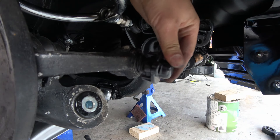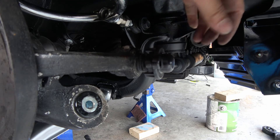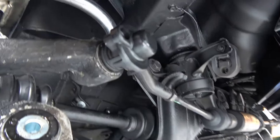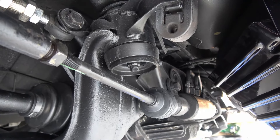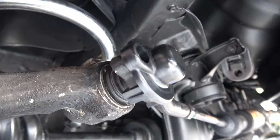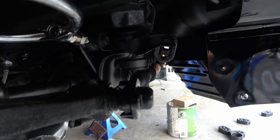Make sure you don't leave your ball joint crooked — it can cause it to prematurely wear and get damaged. Make sure you straighten it out flat, just like that, so it's perfectly parallel. Inner boots are done on the inner tie rod, outer ball joints replaced, new cap — looking good. Let's tighten that down and we'll be done.